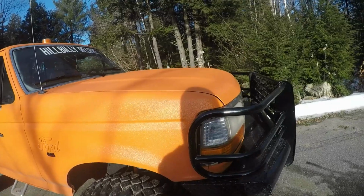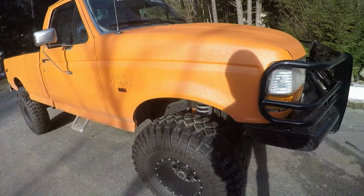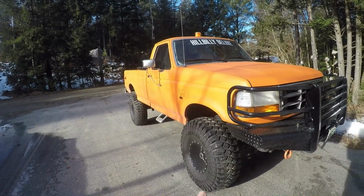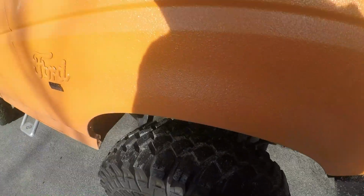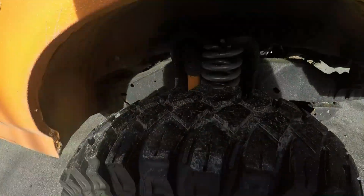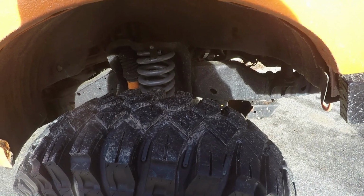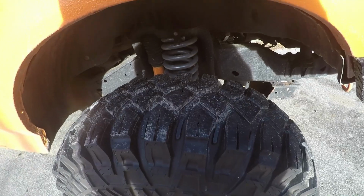in the spring, early summer, whenever I really get the funds to do so. A thing about that, actually, is on the RYD Motorsports website, they make the kit. So to answer your question first, the coil buckets from the 05, I'm sure you could get them to swap to an OBS, but RYD makes coil buckets for the OBS to fit the 05 axles, so that's what I'm going to do.